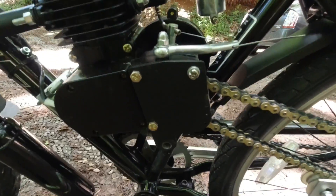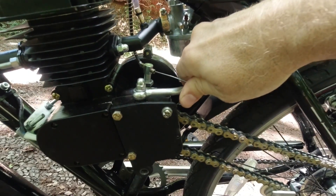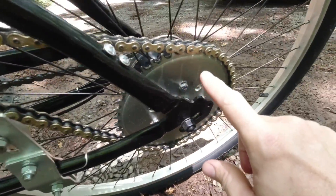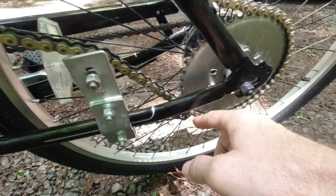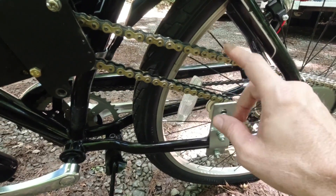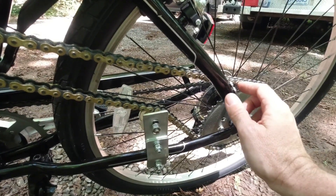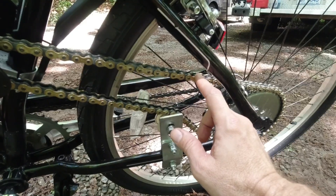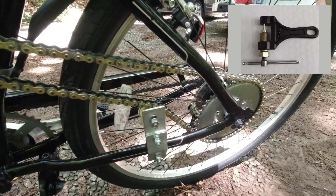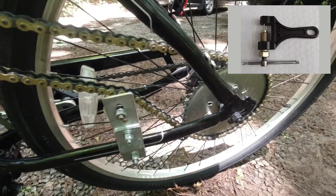Here is your clutch arm. When you pull the handle up there, this comes in and out, engaging or disengaging the engine from this chain. The chain comes around and goes into your sprocket. You have a chain tensioner here — I tried the springy one and didn't like it. I also upgraded to a heavy-duty chain. You do have to cut the chain to the right size, which is a little tricky but not as tricky as it looks. Don't use the chisel-and-hammer method shown in videos — you'll just mangle the chain. I'll link the best chain breaker below; it's very simple with the proper tool.